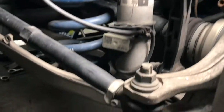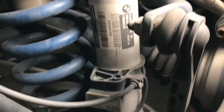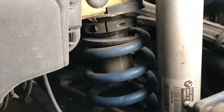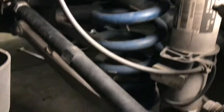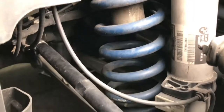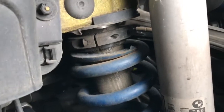If you've never seen behind your wheel before, this is what it looks like. I'm just using a panel light here to get some light in for the video. This is our shock that we're going to be removing — that's the OEM one. I have the Dinan coilover system installed in my car and I'm going to be replacing that. So the top spring mount — all of that is going to come out.